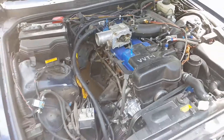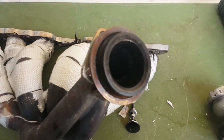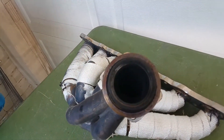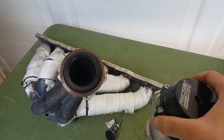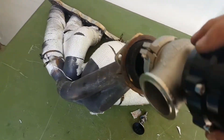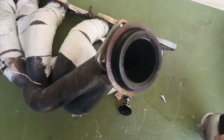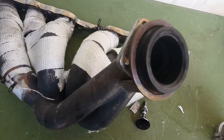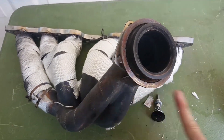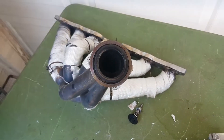I got the whole turbo and manifold taken off, and here is why all that had to happen. There's some BS Chinese flange on there, and I got a precision turbo wastegate — its flange needs to go like this, so it's completely the wrong size. I'm gonna take it to my buddy Jason who works at APEC, and we're gonna cut this off and he's gonna weld on the other flange, and it should be good to go.